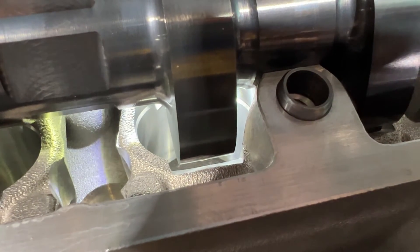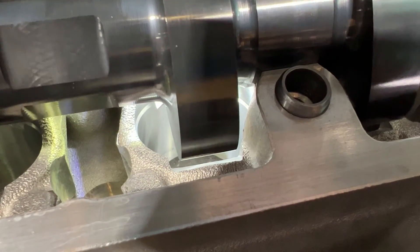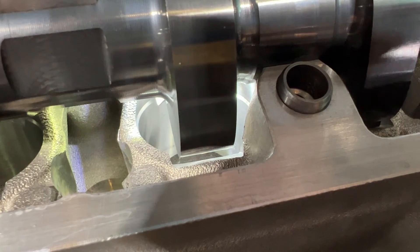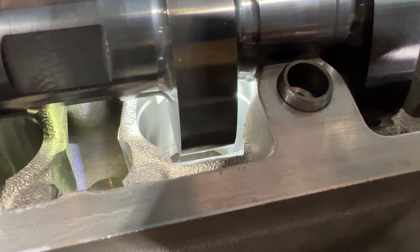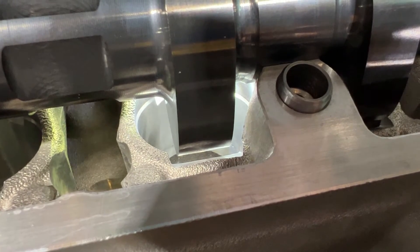This build also gets the add-on service. Whenever we're using a GSC S1, S2, or any of those camshafts, we will relieve the area where the head is close to the cam lobe. Although it does not hit from the factory, we relieve that area so there's plenty of room for oil. When you have the right valve spring for the application and you clearance the head for the cam, the GSC cam is no longer a worry. A lot of people are worried about a billet cam in a 2JZ, but HeadGames has no issues with that because of the part selection and the clearance for cams.